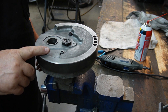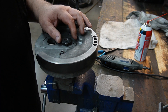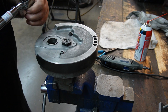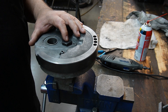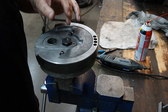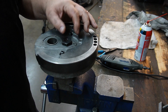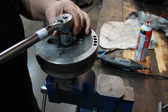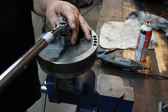When I took these out of the crankcase, I put them on the truing stand and they had twelve thousandths runout, which is pretty high. I fully expected the sprocket shaft or the pinion shaft, or both, to be bent, so I took them all apart, pulled the shafts out, put them on the lathe, checked the runout, and the sprocket and the pinion were only a few ten-thousandths of an inch. So they're good.